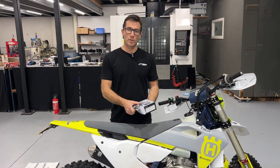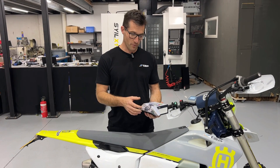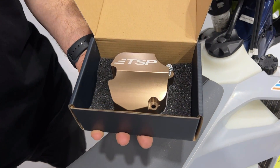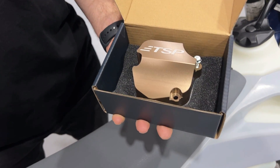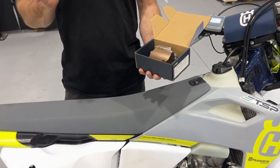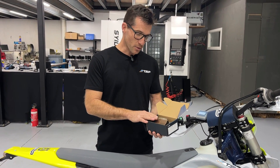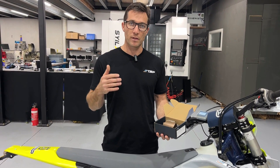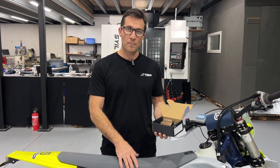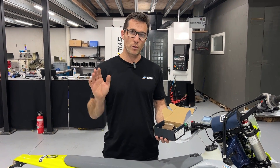We've recently released a brand new product which is an oversized TBI 250 and 300 power valve cover. This video is going to cover the installation of this product. If you're interested in the technical explanation of how and why this product works, we have that covered on our website listing and we'll also do a separate video. Essentially this product helps to boost the low end and mid range power on one of these 250 and 300 TBI bikes, usually in the range of about 3000 to 5000 RPM before the power valve opens.